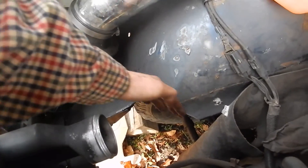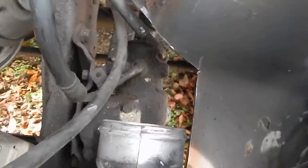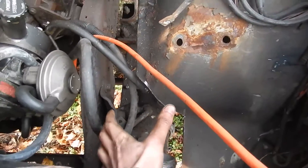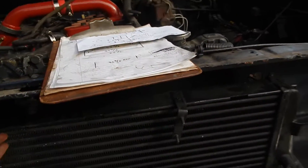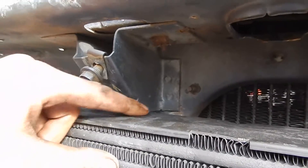So I had to cut out some of this fender over here, and same on the other side. It's pretty close in to the power steering gearbox, so that'll be a little challenging. I think I'll probably use a silicone 45-degree elbow to get out of the way, and then make some tubing to go from there down. It'll be a tight fit. I had to shave off some of that hood latch bracket, and also off of that.